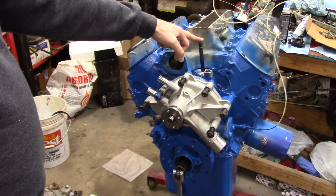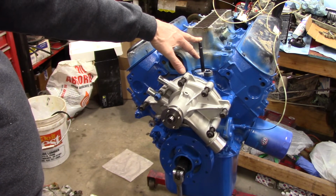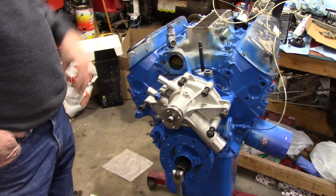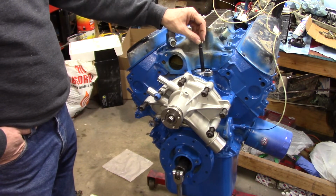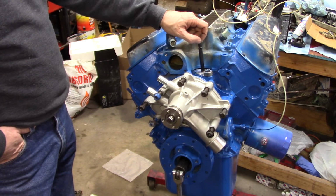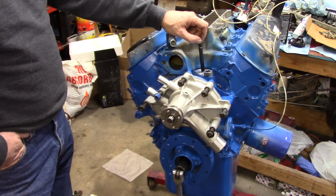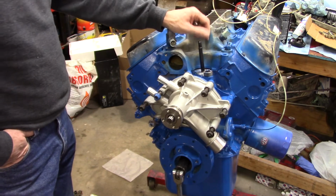Anyway, then once I reprime it, make sure everything's going, I'm going to go ahead and put my distributor in it and just fight around it, putting the engine in. I just don't see any other way around, because if I put this engine in and then I pull this out and that stinking oil pump drive rod falls off and falls down the bottom of that pan again, I've got to pull the engine out anyway. So most likely to get the pan off. I may not, but I'm not going to fight it under the car, I guess is what I'm saying.